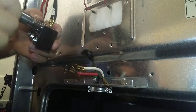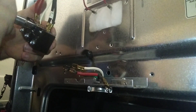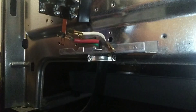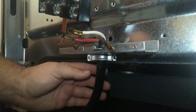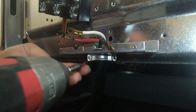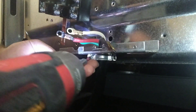Now go back over and make sure you got them good and snug. The next step, we need to replace the old four-prong plug wire — it did get burned on one end. Any time I replace the terminal block, I like to just replace the cord too, just for safety reasons.